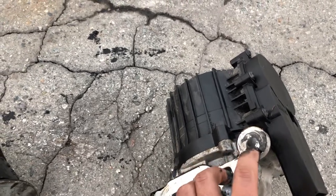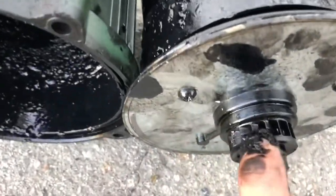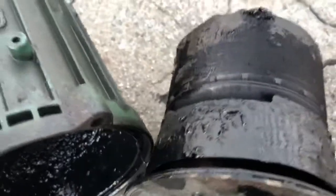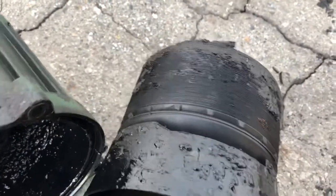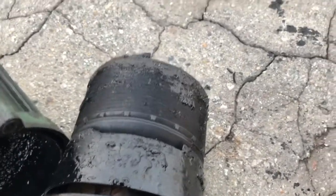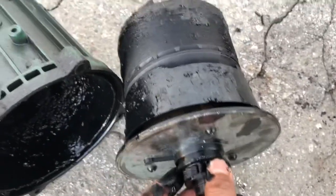As you can see on the Freelanders, this hole here is for the oil pressure. Oil goes in there and hits these small two tabs in here and makes it spin. This thing spins, and the oil that is trapped here goes around and goes back down to the engine, and comes back down to the oil pan.